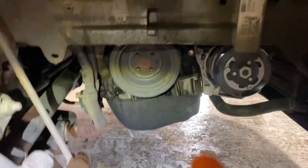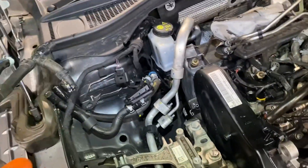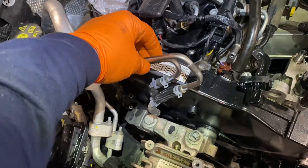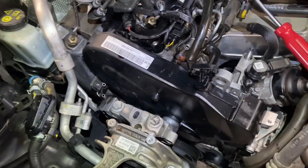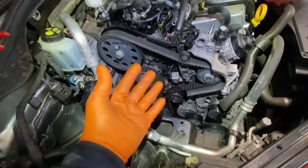I've got a couple of bolts out of the pulley up top, I've removed the fuel filter housing, popped off a couple of fuel lines to give a bit of room. The expansion tank — I pulled off the top hose, left the bottom one on, and fed it to one side. DPF pressure sensor pipes I've popped off and left connected to the sensor. At this point we're going to support the engine and get off that engine mount — not that hard of a job. We have the engine mount taken off, the crank pulley and the covers taken off.